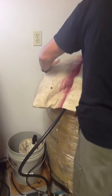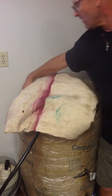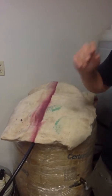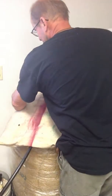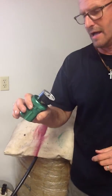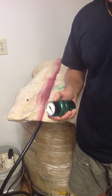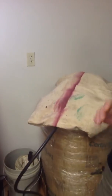I use a tarp — a 20-by-20-foot tarp, folded down to about a three-by-three square. I kind of cup out the bung holes so I get evaporation. When I want to check if my oil is dry, I put my glasses down under the bung hole and put them on — if they're fogged up, I know I'm still evaporating moisture. If you don't own glasses, just get a mirror. For those who think we do it the hillbilly way, we also test with the Sandy Bray water tester. I get my oil to where it consistently passes at around 300 parts per million — I'm usually right between three and four on the first sheet. 300 parts per million is pretty dry.